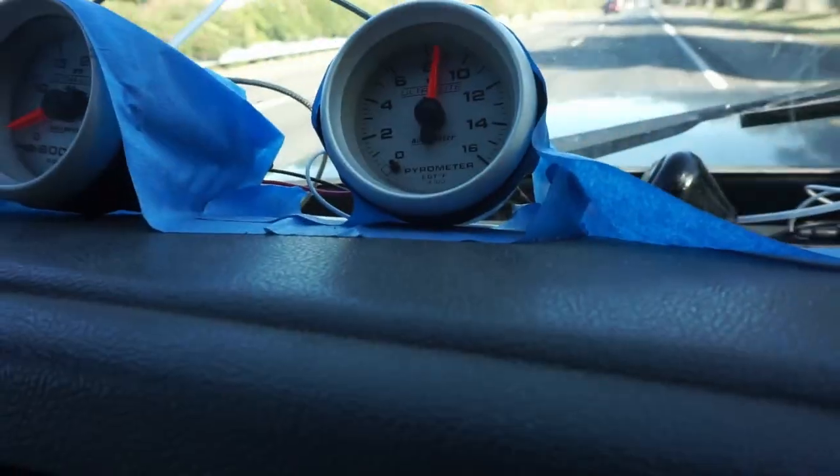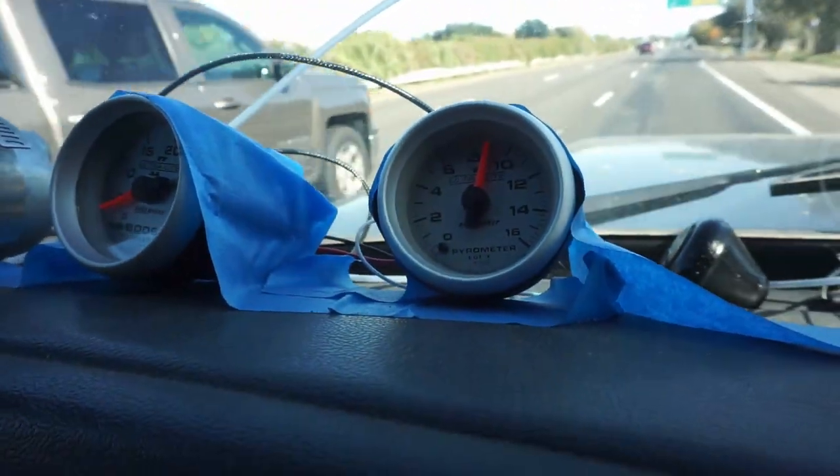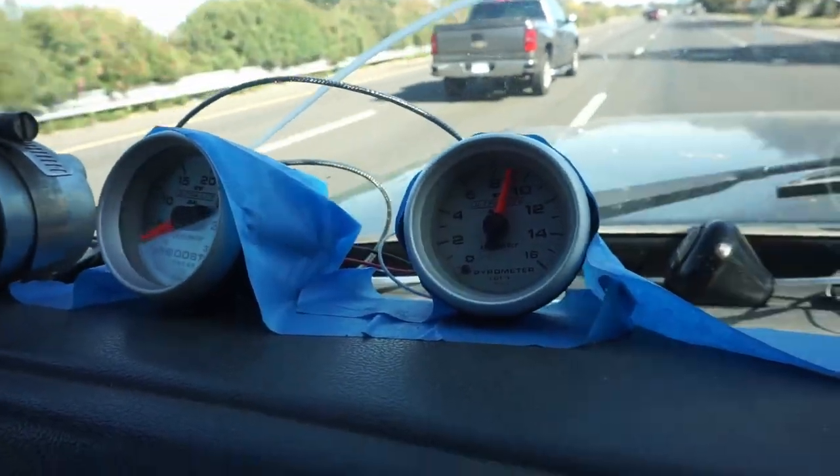Now we're dealing with exhaust gas temps, which high EGTs are always the enemy for diesels. And with all that boost pressure that we're anticipating but not getting, we just end up overfueling the thing, driving up those EGTs, and not only are we not making the power, but we're heating the crap out of our engine when we shouldn't be.